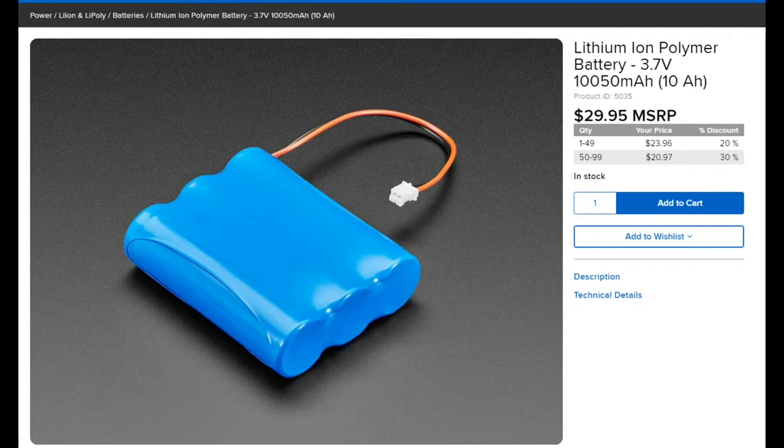In comparison, a 10 amp-hour battery at 3.7 volts is maybe 35 watt-hours. The e-bike ones we're talking about are 10 to 15 times larger. They can have like 15 to 25 to 30 of these standard 18650 batteries. You have to charge them very fast and they have to discharge very fast, because as you throttle up to go up a hill carrying you and your bike and all your stuff, they're going to have to discharge a lot of current.